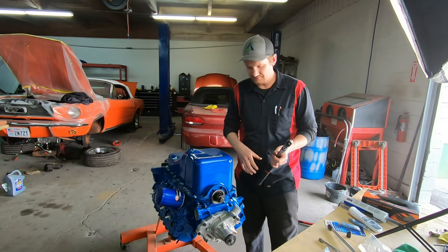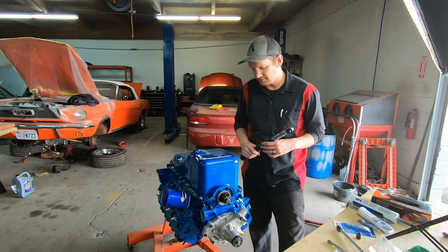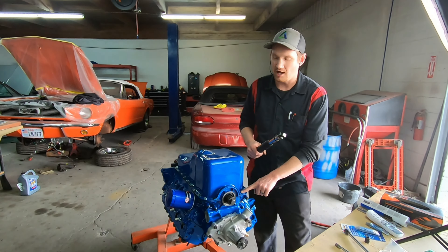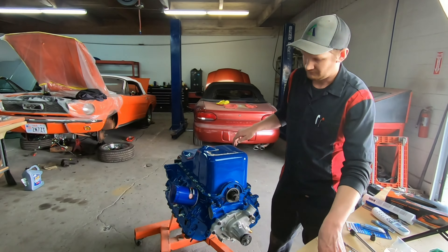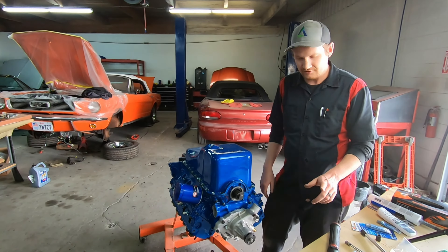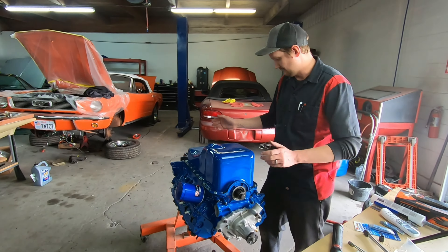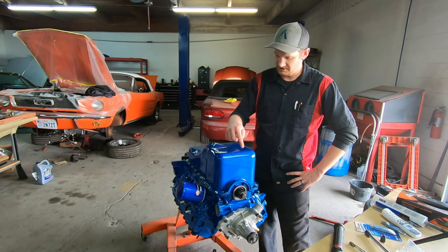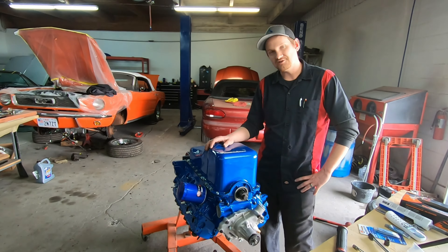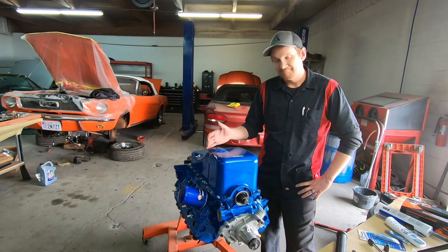I went around a couple of rounds. Seven foot-pounds feels much better on the smaller bolts, and I'm not going any further than that. On the larger ones I went to nine — feels perfect. I know this is a relatively simple video, but that's the oil pan. Those are the gaskets I like to use — the one-piecers. I do like to have all new bolts. I'll put links in the description for the gasket; this is also an ACP oil pan. That's it — we're one step closer to having this engine done, so we'll catch you next time.